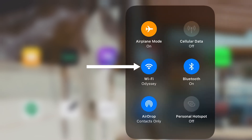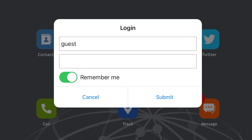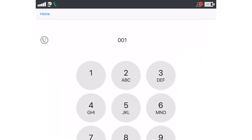Now it's time to make a phone call. For demonstration purposes we're going to call the Satellite Phone Store. First, put your phone or device into airplane mode. Then go to your Wi-Fi settings and select the Iridium device. Go into your app and log in as guest with the password 'guest.' Click on the phone icon. Here's an important step: you must put the country code before the number. Here in the US that's 001, then the area code — you don't need another one after the 001.